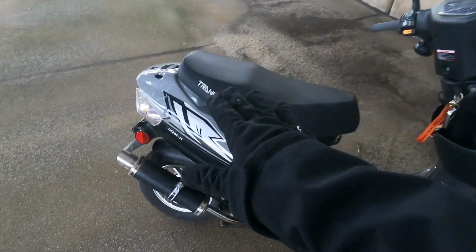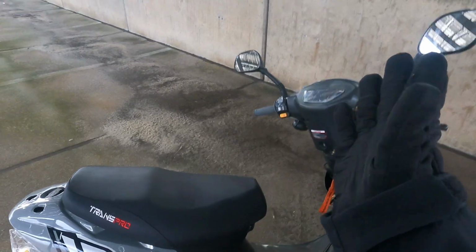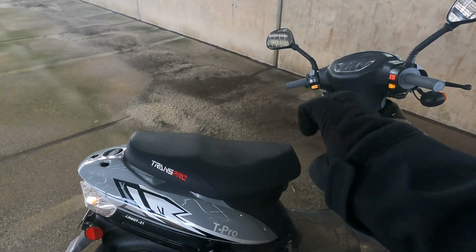You want to have your butt right here, no weight on your feet, lean over and pick it up as you press the throttle, and keep your fingers on that back brake. It'll save your life. You can't be scared to drop back. The back brake will save you. Just have your life in that back brake and you will be okay, I promise.